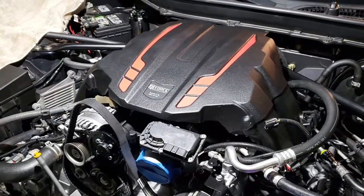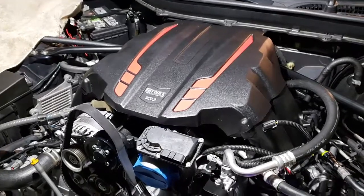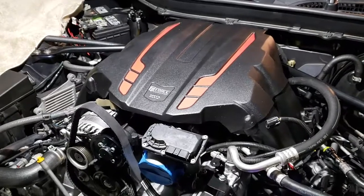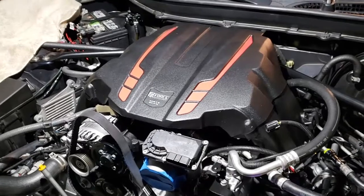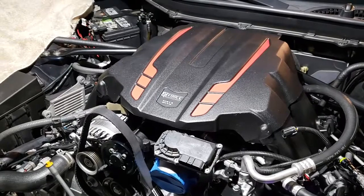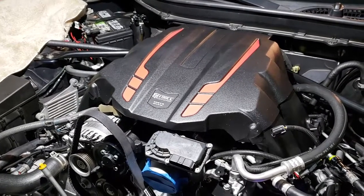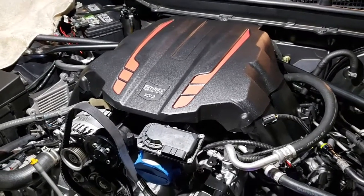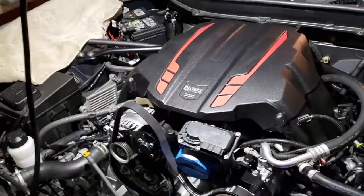So just imagine some of these cars, like my truck has a lot of blow-by. It just ruins your engine. That's why those Volkswagens have tons of carbon. And some of the BMWs, all these direct injection cars are even worse because you don't have that fuel injector cleaning off the valve. Get yourself a catch can first thing, even on your normal car. All cars need at least a minimum of a small one, just go get a $20 catch can on Amazon or eBay. Just get the cheapest one you can get. At least you have something pulling the oil out instead of nothing. Okay, get at least something.